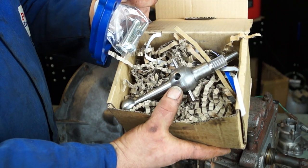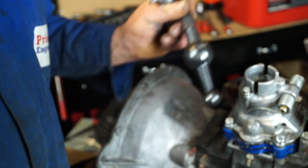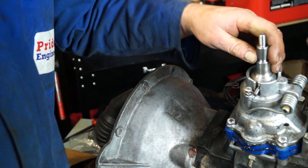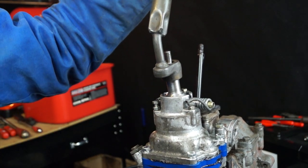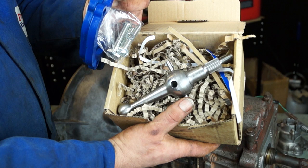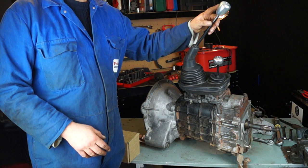You also have some bolts and a lower gear lever assembly which is longer than the original — that's why you need packing spacers. The whole idea is to achieve less of a throw when you're changing gears, and this is very effective. You might find a little hamster living in the bottom of the box, but I very much doubt it. So we're here to learn how to fit it because you're already sold on it.